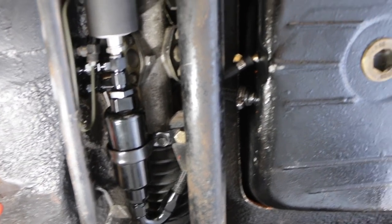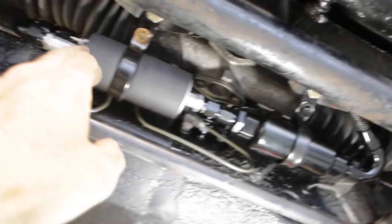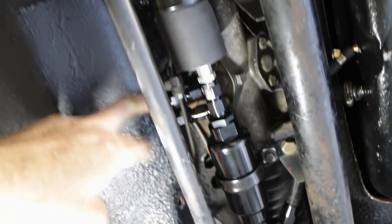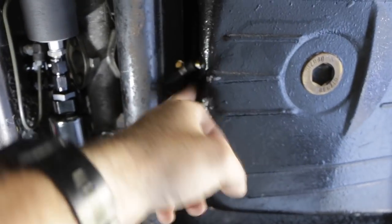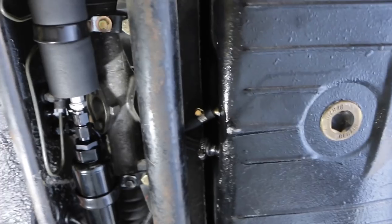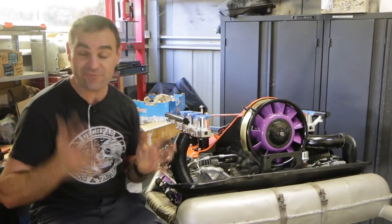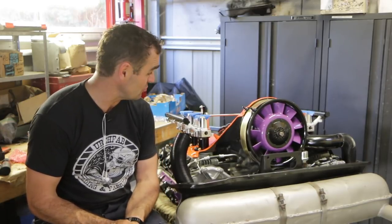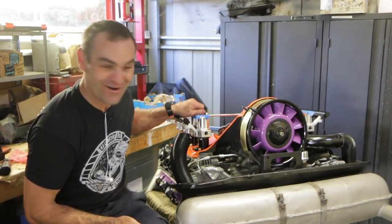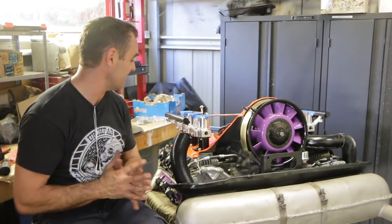We actually have our fuel pump all plumbed in. The fuel goes from here through that line into the fuel filter, through the fuel filter and fuel pump, into the AN line here which goes through to the back of the car. The return comes in there, goes up over the top of the steering rack and comes back down into the fuel tank. We're done except for wiring, which I'll do later. I went from a horrible day where nothing seemed to work, to quite a successful day today with nice shiny new ITBs. I'm in love with these things — the action is so smooth.